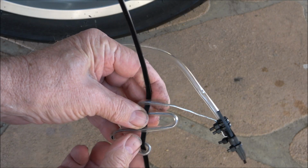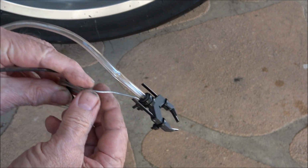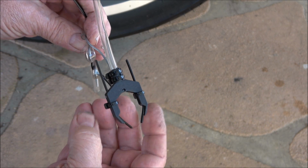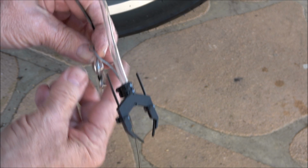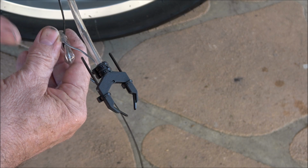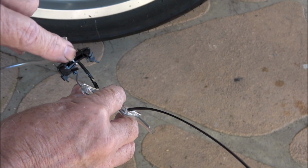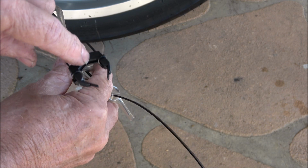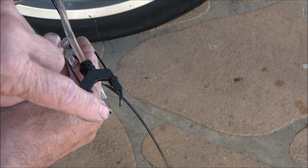Here's our support, which we'll attach to the swing arm like so. We've got our claw, it comes out onto the sprocket. Got a tube coming down, which the oil feed comes in through this point here. It'll be fed down into this area here. It'll drip down, follow down along here on the tie clips, and just drip down from there.